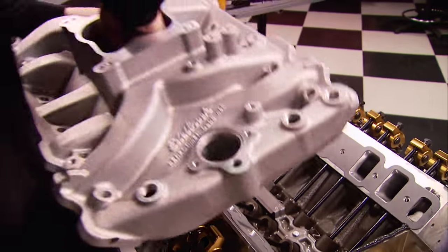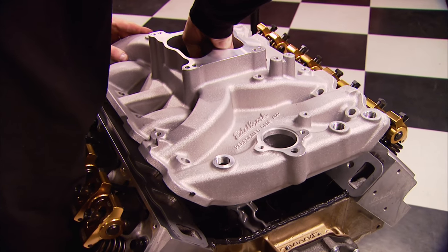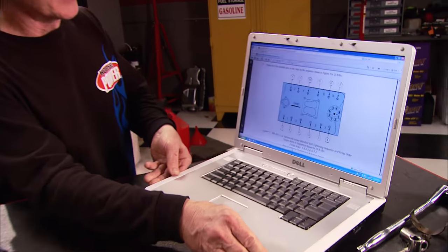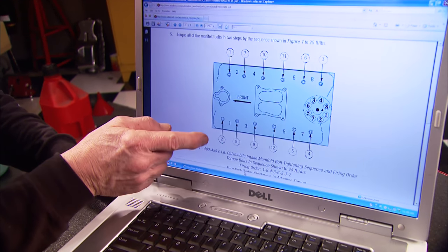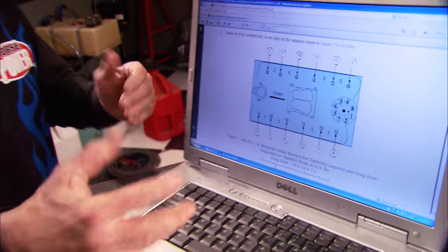Take your time with it — you don't want to have to do it twice. We're not going to torque it down now, and here's why. Each situation is different depending on whether you're dealing with cast iron or aluminum, or whether you're putting motor oil on the threads, assembly lube, or nothing at all. You just go to the manufacturer's website. In our case, Edelbrock has a diagram of the 455 showing torquing from the outside in — that moves the gasket inward a little bit and helps prevent water jacket leaks which occur on the outside.